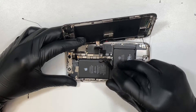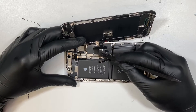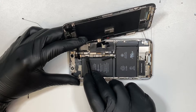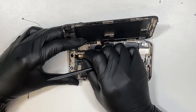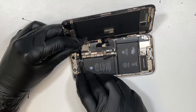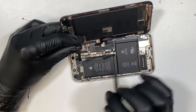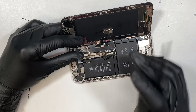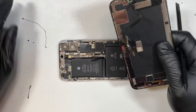Now that the battery is disconnected, go ahead and remove the second cable — that's your LCD — and then the one on the back is for your screen. Once you remove those, coming from left to right, remove the second connector. Pop it up and then gently pull the cable. Do not break the cable, because there is double-sided tape holding it to the base of the phone. If you snap this cable, there goes your phone. So take your time and slowly open it up.